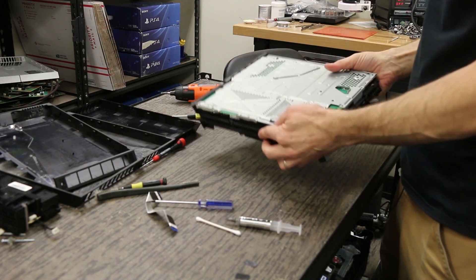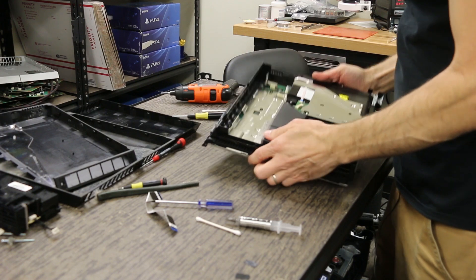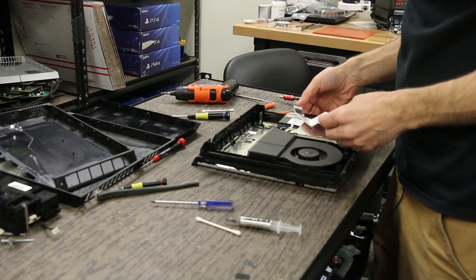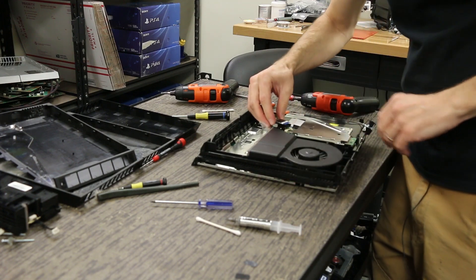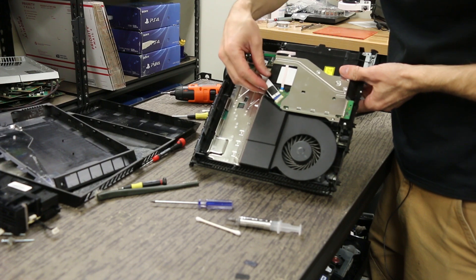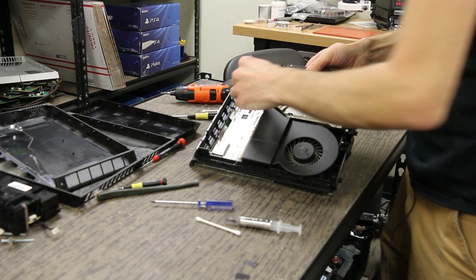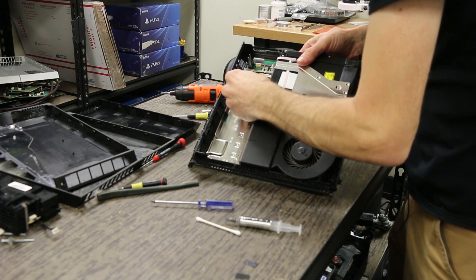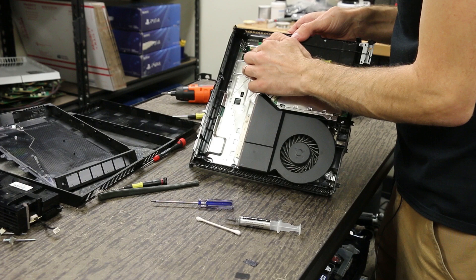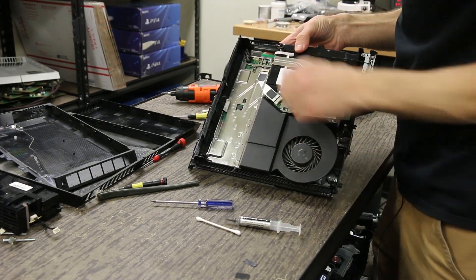If you don't put the screw in right away, you could move it and the hard drive could slide out and fall, which can be a problem. Next, put the ribbon cable back in for the optical drive — just slide it in until you hear it click. Same with this one. Then the Wi-Fi antenna: just line it up and push it on with your finger.